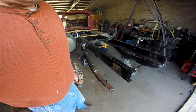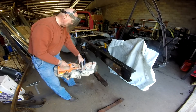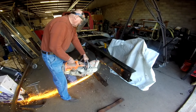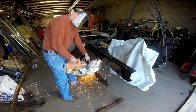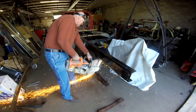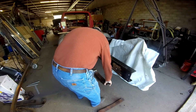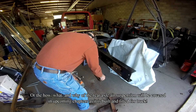It cuts through, just kind of slow going. For those of you new to my channel: I'm cutting these leaf springs off. I'm going to use the front part of the leaf spring as a stabilizer or pivot bracket for the axle, and extend the rear out to accommodate airbags for the air suspension. That's been covered in detail in other chapters of the haul truck build, so check those for further details.